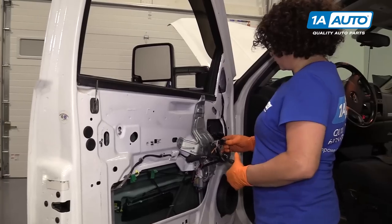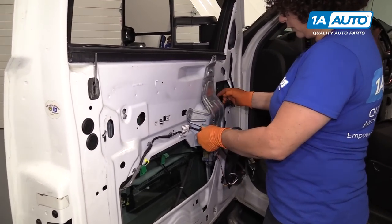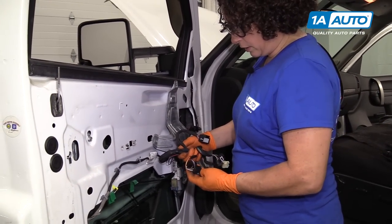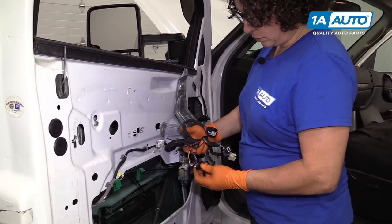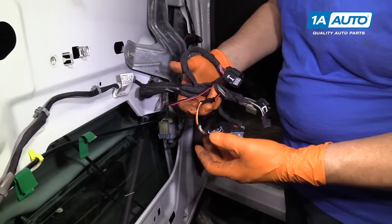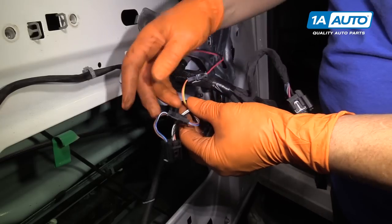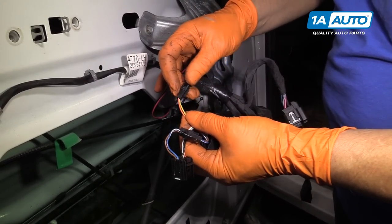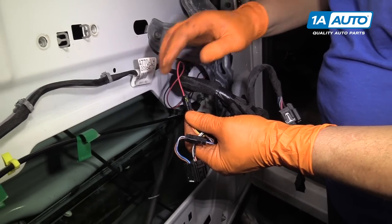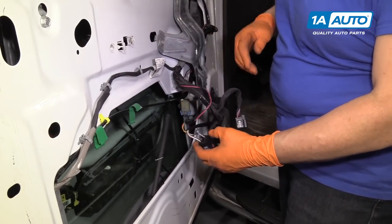So now I'm going to put the driver's door panel back on. I like to clean this up a little — tape this in there, make sure it's not hitting anything. Make sure you connect your new mirror connector harness together. The mirror harness is the factory harness — those two connect together and the yellow and orange connect to the black and red wire that you ran through the door. This door panel is the exact same way as the passenger.